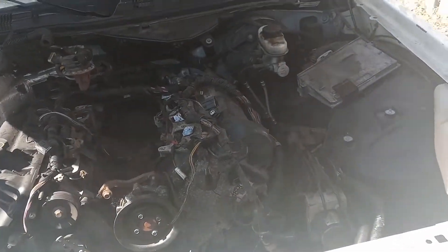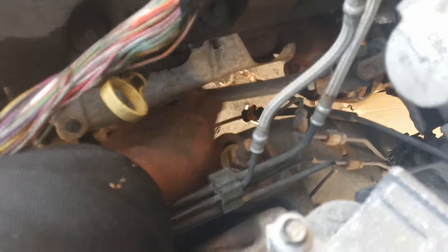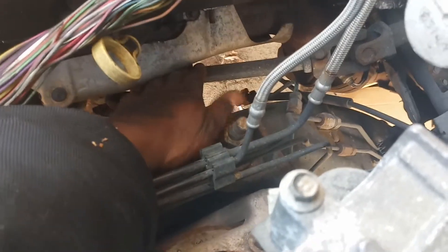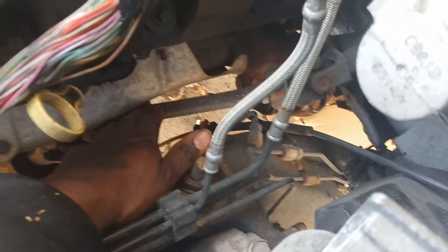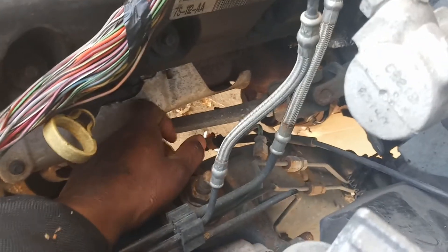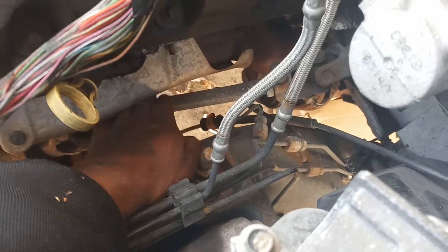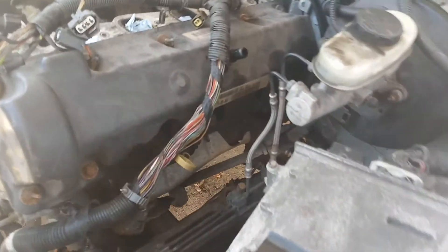Hopefully this week — I'm going to say definitely this week — I should have the engine out sitting on the ground. I'm gonna do a couple of test fits of the header. I'll probably have to take apart the steering shaft right here. It doesn't look like a lot of room, but with this shield removed it might not be as bad as I think to get those Mustang long tube headers in. The plate looks about a quarter inch off the stock log, so I might get decent room with a bit of modification.